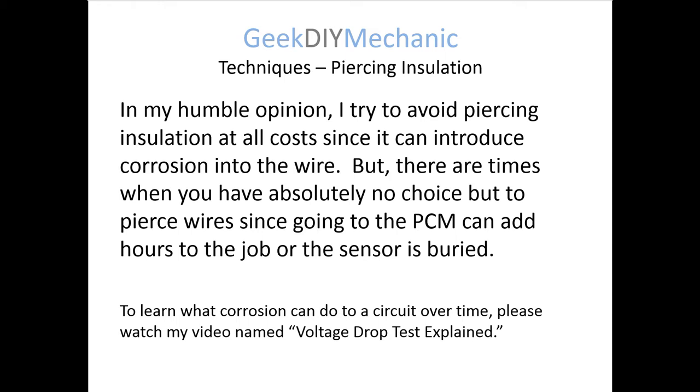I try not to use this technique. What I don't like about it is that unless you go back and re-protect the insulation that you pierced, you're actually piercing through the insulation into the wire. Once you pull your probe out, that wire is potentially exposed to the atmosphere. Whenever I work on a car, I try to be less intrusive as possible. If I do pierce the insulation, I mark it and go back with either liquid electric tape or electrician's tape to really cover it and reduce the possibility of future corrosion.